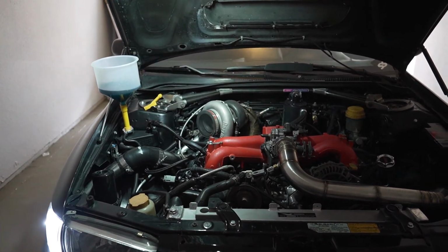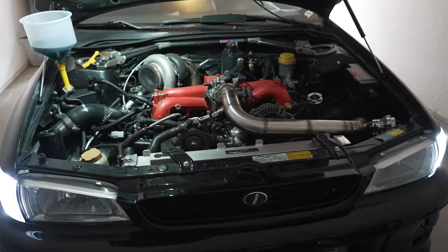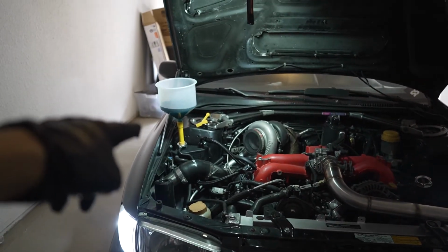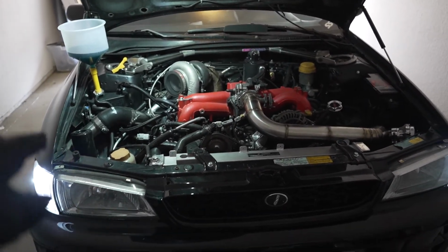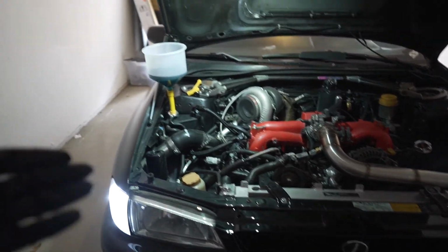And then once it gets through the 3rd cycle, you want to rev it up to around 4,000 RPMs. Anywhere from 3,000 to 4,000 is perfectly fine. Make sure you force any extra air bubbles on out. Let it idle one more time, one more cooling cycle with the fans turning on, and then you should be pretty much set. That's pretty much all there is to it.